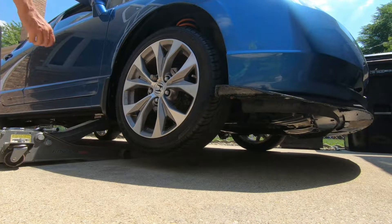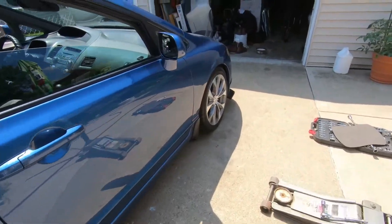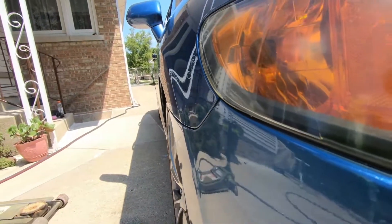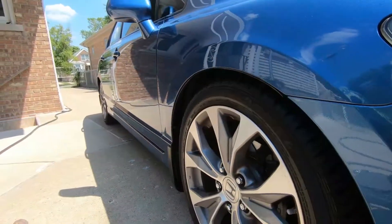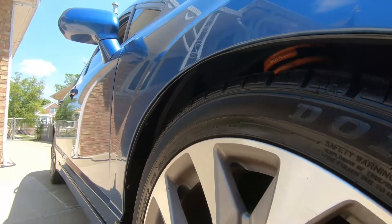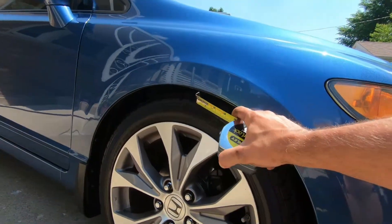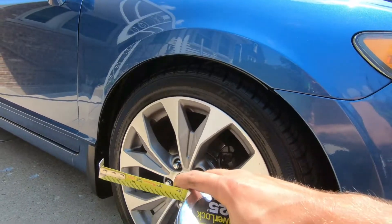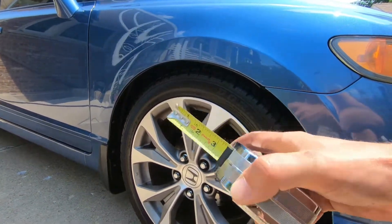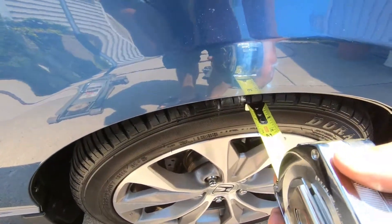Here comes the moment of truth. And there she sits — she's poking a little bit more. Does it look better? Of course it looks a little better. Even with the 17 mil spacer there's plenty of room underneath the weather stripping, so it won't be a problem. The only thing is, the further you stick out your wheels and tires, the wheel gap seems to increase a little bit — when the car was tucking the tire more, the front end looked lower. Now that the tire's out you can see more gap. Let's check out how much more space we have.